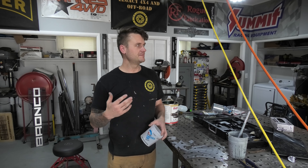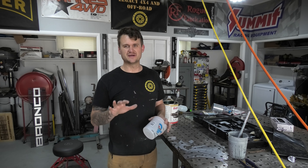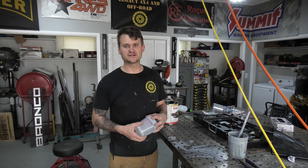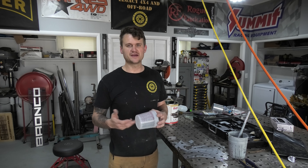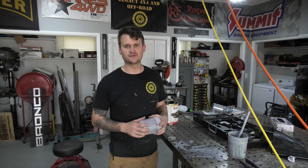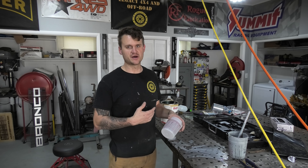We got the primer onto the Bronco now. I had a similar issue as with the Commando — I was able to make it work a little better this time but still had some spraying issues. It's not the thickest, greatest coat. I got tired of dealing with the spray gun not spraying properly. I think I just need to add a lot more reducer to it — it really is a high-build primer and it struggles coming out of my guns.